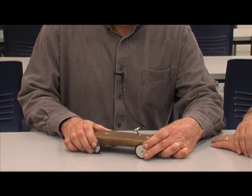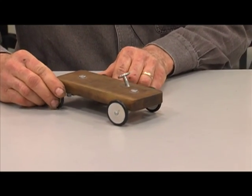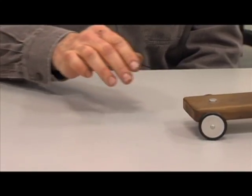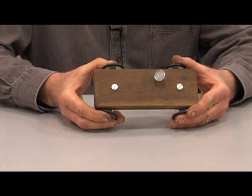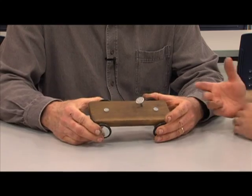Well, it'd be nice if it did drive itself. Sometimes it looks like on the track like it's driving itself, because it looks like I'm not even there. But basically, because of the way the racetrack is shaped and we always turn left, we can set the car up so that it turns automatically. By the way the suspension rolls, you can have some rear steer in the car. As the suspension moves, the wheels will actually steer in this direction.